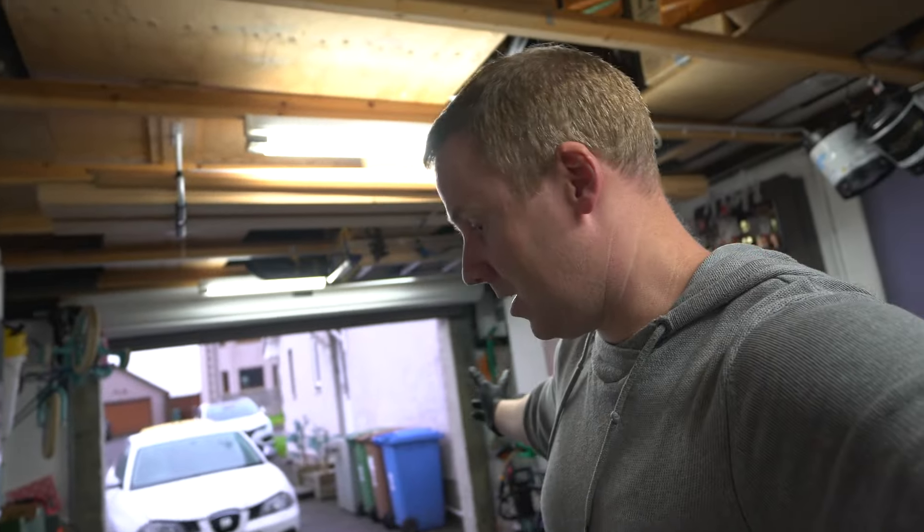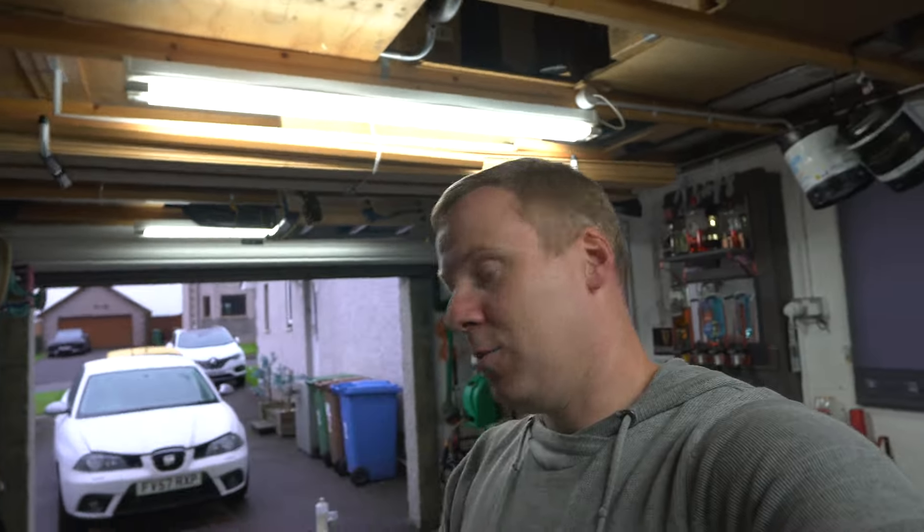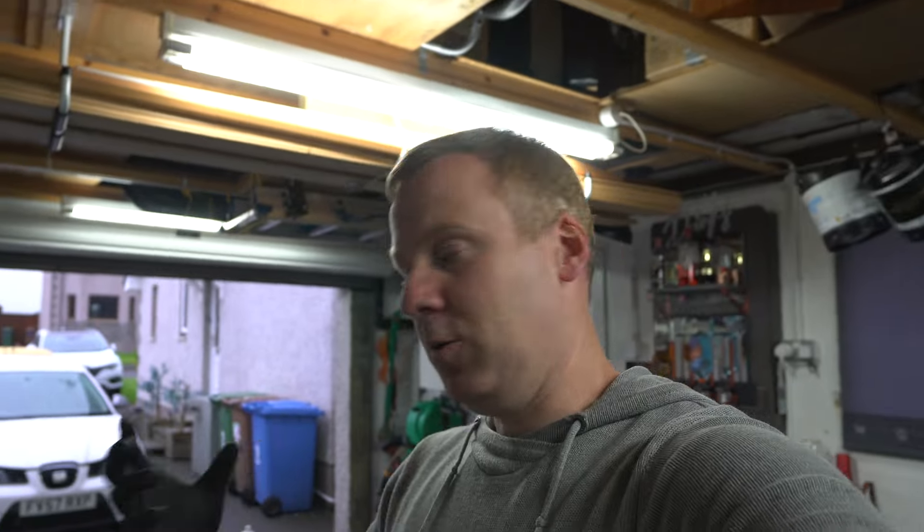Before we get into changing the starter motor, let me run through a few things I've fixed on the car since then — niggling issues that were bothering me that I left a bit open at the end of the last video. The brakes had been spongy since day one of getting the car back on the road. In the end it was because the ABS module brake system needed to be bled, and you can do that through OBD11 or other diagnostic tools — you can get the ABS pump to start pumping as you're doing the brake bleeding at the same time. This releases the last bit of air trapped inside the top of the ABS pump, otherwise it only gets pushed into the system once the engine's running on the road, which is why you feel that spongy feeling. The brakes now are perfect — really sharp with no more spongy pedal.